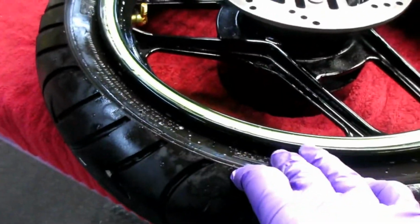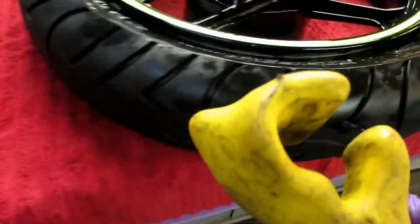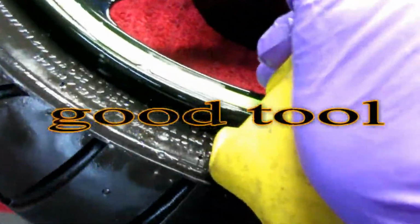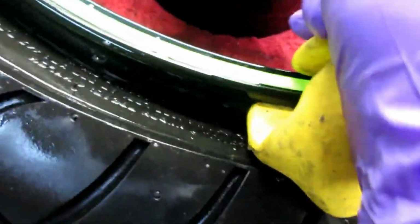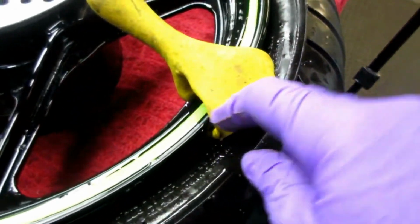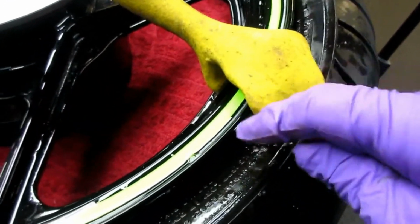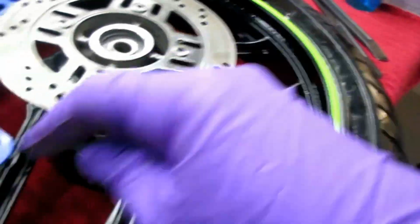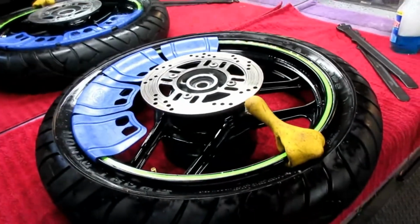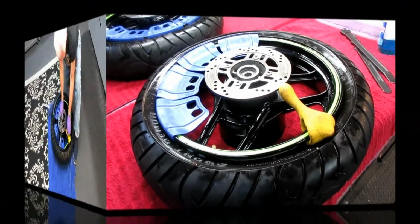They also have a thing called a dog bone, and I wanted to show this, that's helpful on some rims. And you can use this. I don't always use this, to be honest. But we'll give it a try today, and let's see. This holds that. Let me just get it down in there. Okay. And what that does is hold that part of the tire down in there while you have your knees at this point and this point, and then you can pry the tire up. And let's see if I'm right or if I lied.